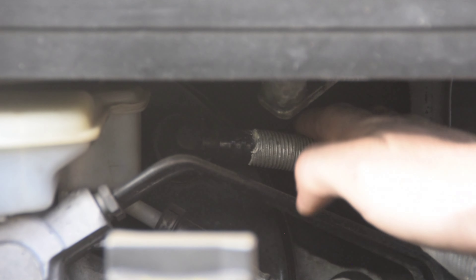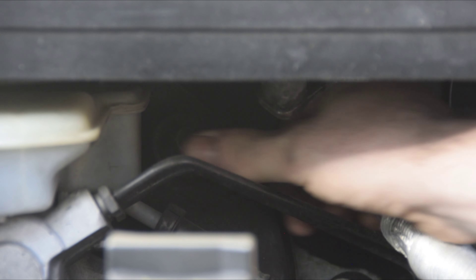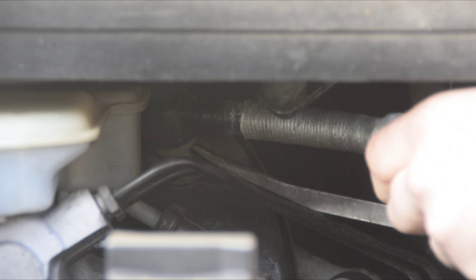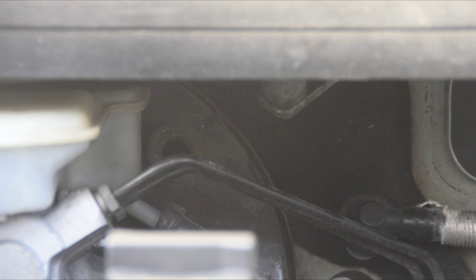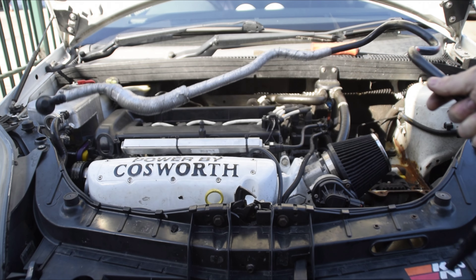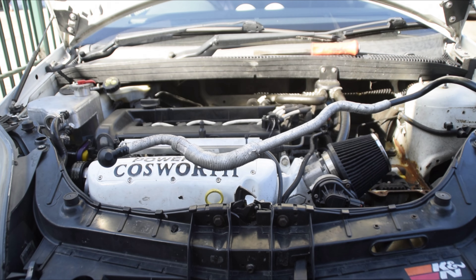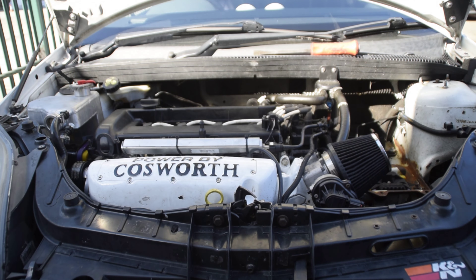The brake line is on the other end of the servo, so we'll just try and wiggle it to get the pipe out. As you can see, that's the pipe out of the way — all sorts of weird and funny shapes. Now we're going to go over to the vice and get our new AN fitting fitted to the actual braided hose itself.